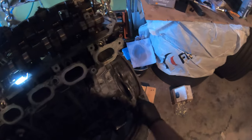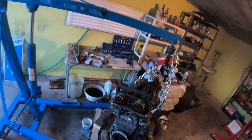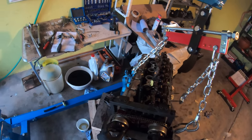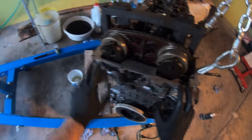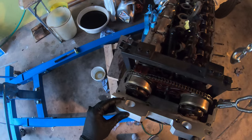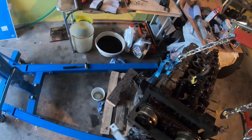The key is in, so the engine is locked at top dead center. Now we're going to set the timing. We still have the cams locked from before, and now we're going to use the last little tool to set this up so that the VANOS is also timed. These little pieces need to be around those parts. You want to use this tool — set it up so that the little tabs fit into the little holes there. Of course it's loose — we need to put in the tensioner.